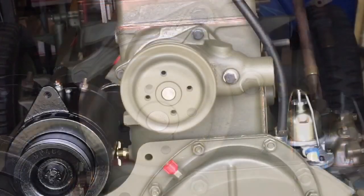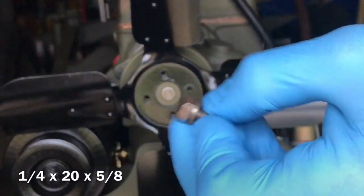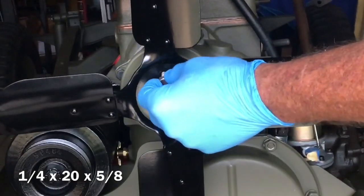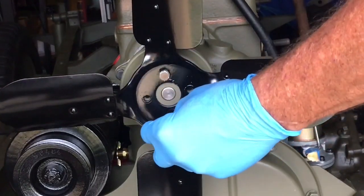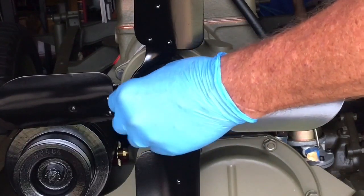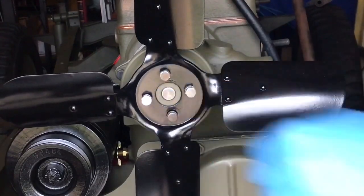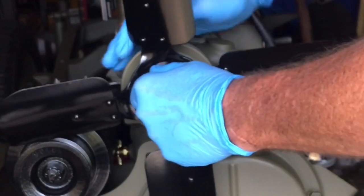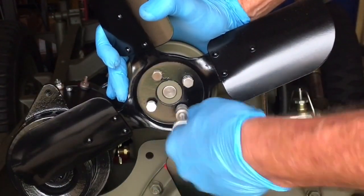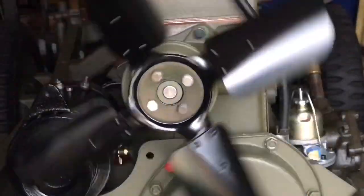I'll go back in and clean up any excess sealant. Install the fan onto the boss of the pulley, and using the 1/4 x 20 x 5/8 inch bolts with a lock washer, install the four bolts. I like to install all the fasteners onto an assembly loose at first and then tighten them up with a ratchet and a socket. This allows you a little bit of movement to make sure the part is on square. Holding the fan so it doesn't move, tighten all four bolts down. The approximate torque value on these four bolts is about six to eight foot pounds. Once you've got all four bolts tightened down, give the old fan a spin and give yourself a hand — your water pump and fan are installed.